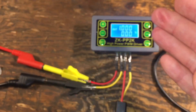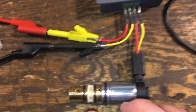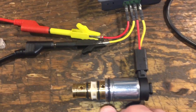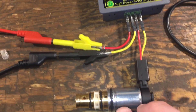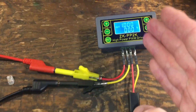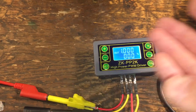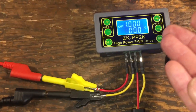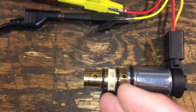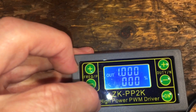This works exactly like I'd hoped it would. Servo valves used to do this kind of function in the past, but in a modern automotive application more and more stuff is a solenoid valve which is duty cycle controlled. This little rig cost me eight bucks, maybe found it on sale on Amazon, but it's very little money and you can effectively test these solenoid valves.